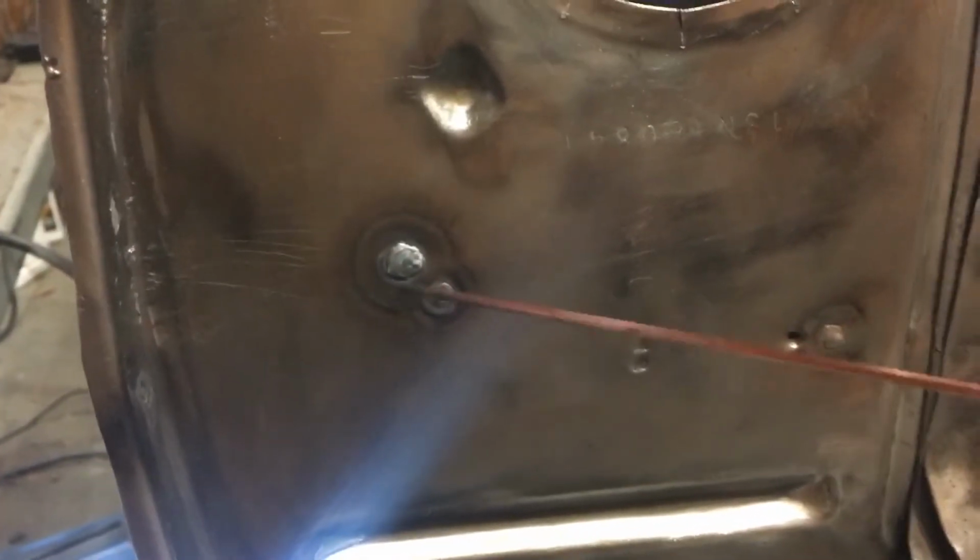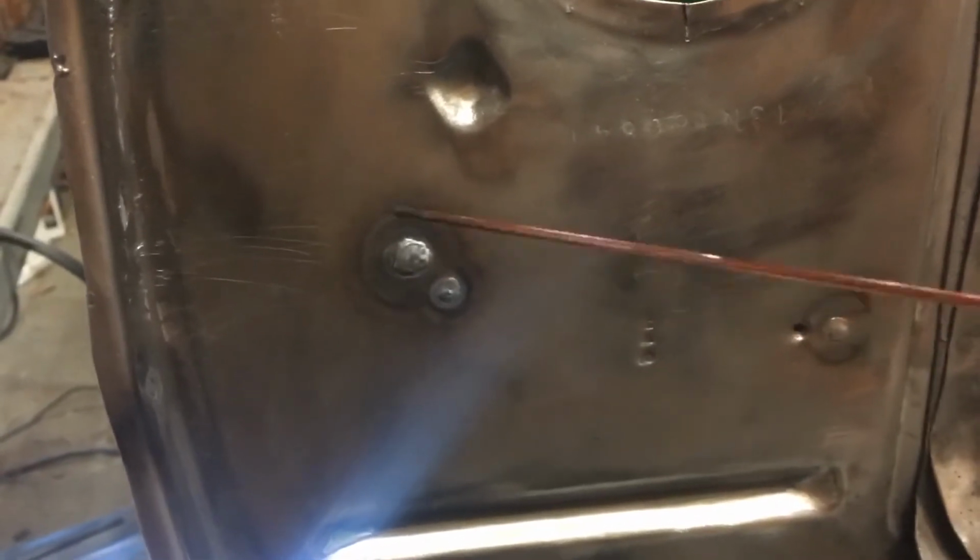but I'll just point out as I move around to the back here, this is the back side of those welds, and they look like little domes on the back too. And so by doing that, I was able to actually get that to work out. So that's a method I'm going to try. So kind of a 2-process part. First, get the metal in there, cover the hole. Second, remove the backing plate, jack up the amps, try to get a little dome on both sides.